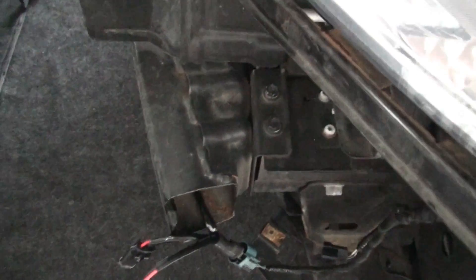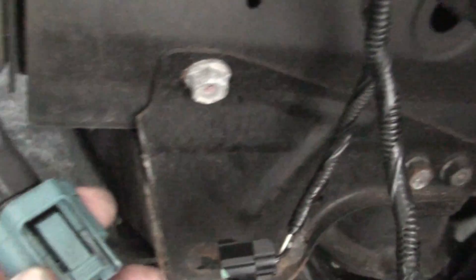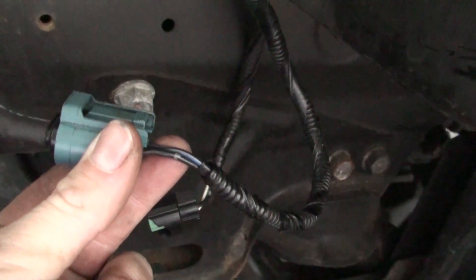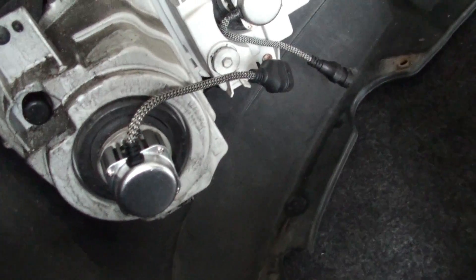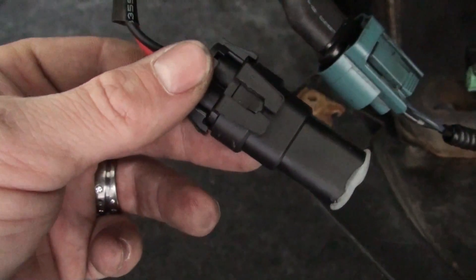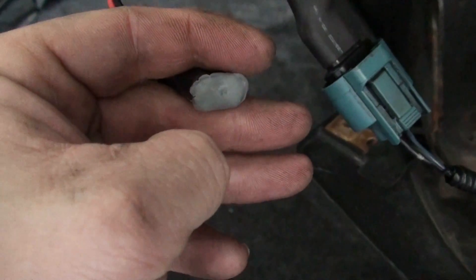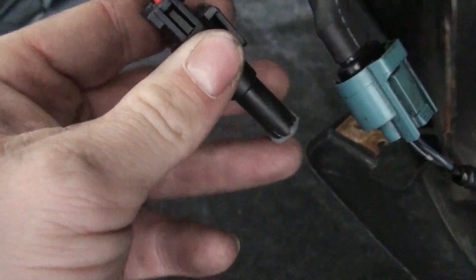To make this work — on the driver's side you have the wire harness plugged into your existing harness, with an output that goes to your fog light. The kit comes with two resistors but you only need one. For the spare plug, I sealed it up with hot glue to make it a little more watertight. Then I passed the wiring through the actual bumper because it's direct and out of the way.